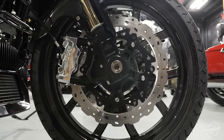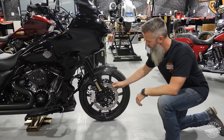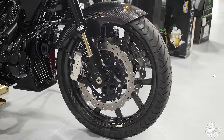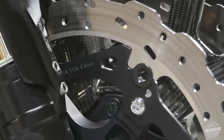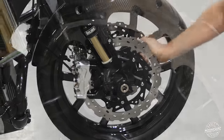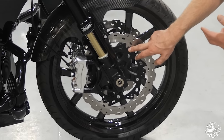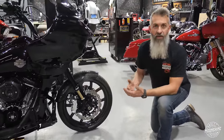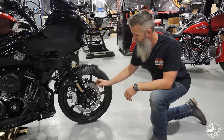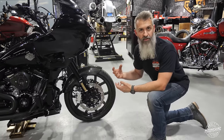Carbon fiber rims — we've got BSTs front and rear. We're doing a 19 front, 18 rear, and these are the Torque Tex. We have a full 320mm floating rotor on the front. The reason we go with these style floating rotors is the inner rotor ring bolted to the rim has a stop that hits your braking rotor stop. When you grab the brakes, you're putting all the pressure between the two pieces on the rotor instead of putting all the pressure on the bobbins to wear out. These just handle the weight of the baggers. Some other brake rotors without that system — the bobbins wear out and you get movement and noise.